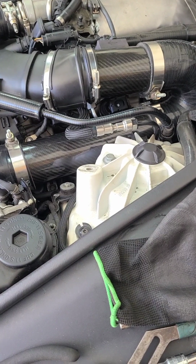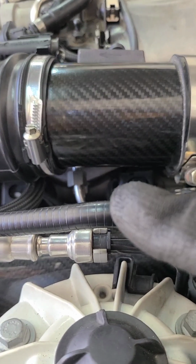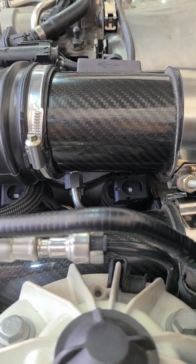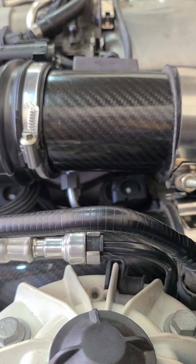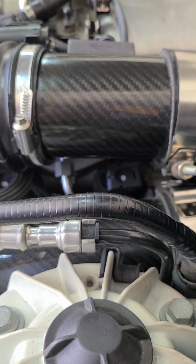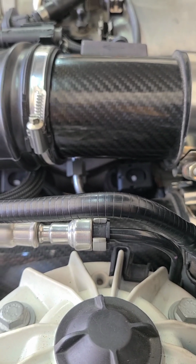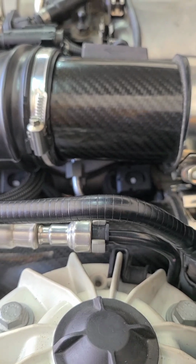But I ran into a problem, like I said, with that bottom fuel line. I probably would have been done, but that set me back maybe about an hour waiting on getting answers back from people online and people that I emailed and things like that. So, like I said, one guy said just to bend it, get it lined up, and then let the nut do the work to pull it back up there and seat it. And it looked like it did the job.